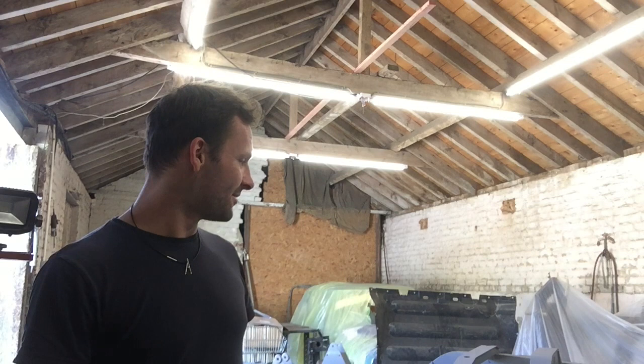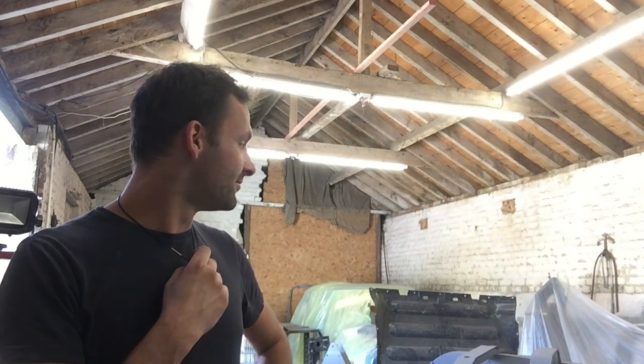One thing I would advise, if you're painting a bare metal chassis, or if you're painting a galvanized chassis, use red oxide primer, because you can see it better. The first coat was very patchy, a bit of a pain to do, because I just couldn't see what I was doing. Second coat is much easier, because the grey really starts to show through. So yeah, I'm quite happy.